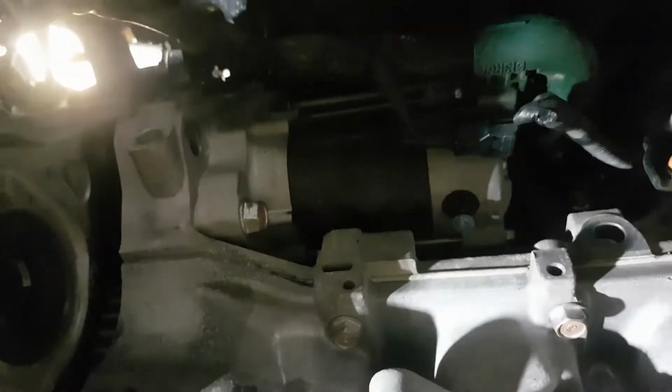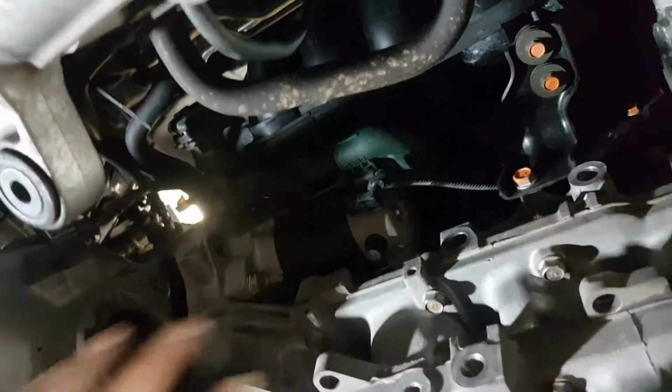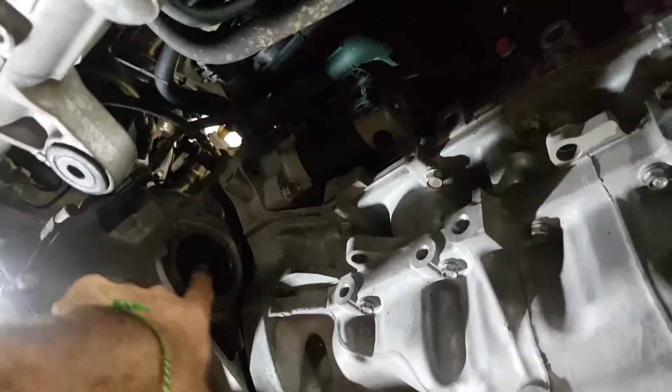Note that you do not need to touch the starter motor bolts on this model. Okay, it's a sort of newer design where it leaves the gearbox out of it. Maybe Honda's always done that. Watch your axle seals, though. Out of any car I've worked on, this will be the least that you ever damage. It's got the lowest chance because you don't have to battle with the drive shaft to take them out. Every single thing works beautifully.